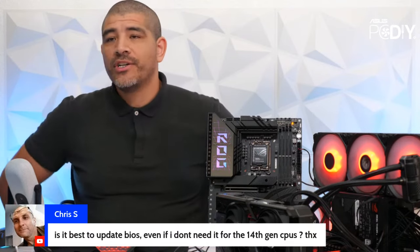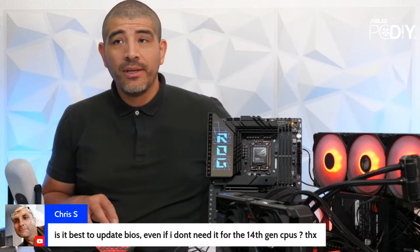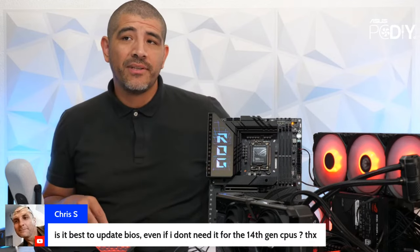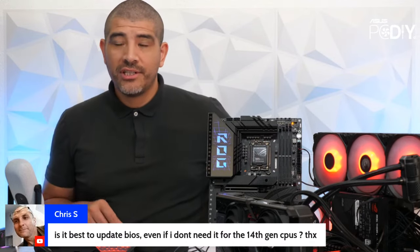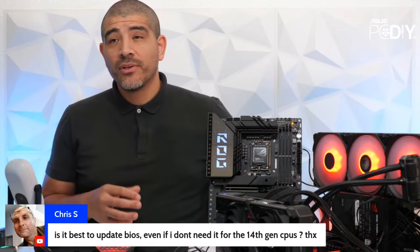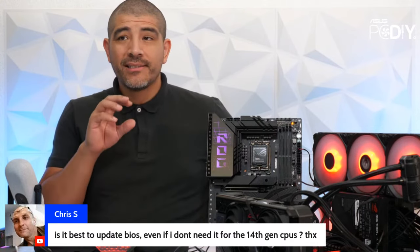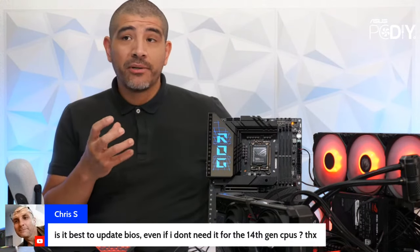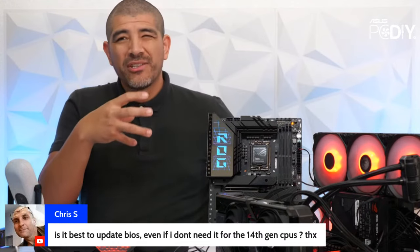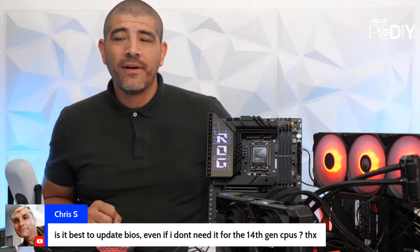That's actually a really great question. In my opinion, I would say no. The UEFI BIOS maturity was already very, very good for Z690 and Z790 for both 12th and 13th gen series CPUs. There is sometimes a little bit of difference in what's called the memory training policy or the memory auto rules. In some situations you might get a little bit better DRAM scaling or performance scaling, maybe on 13th gen than you would under a 14th gen series UEFI.